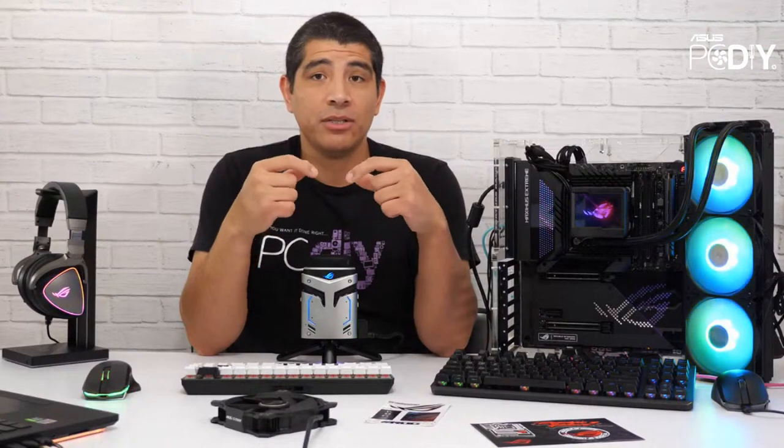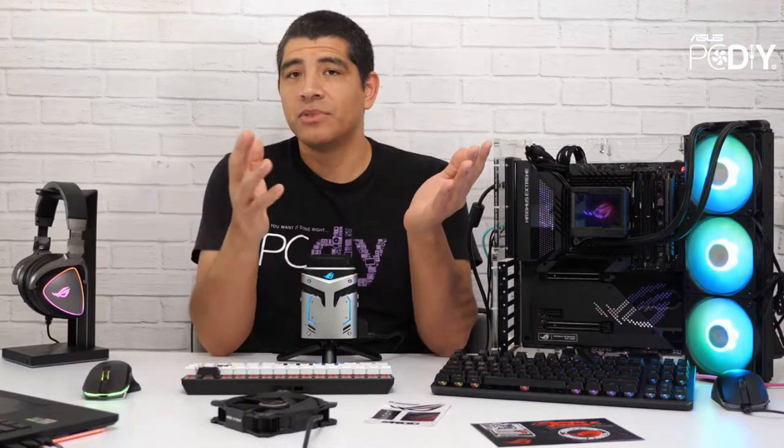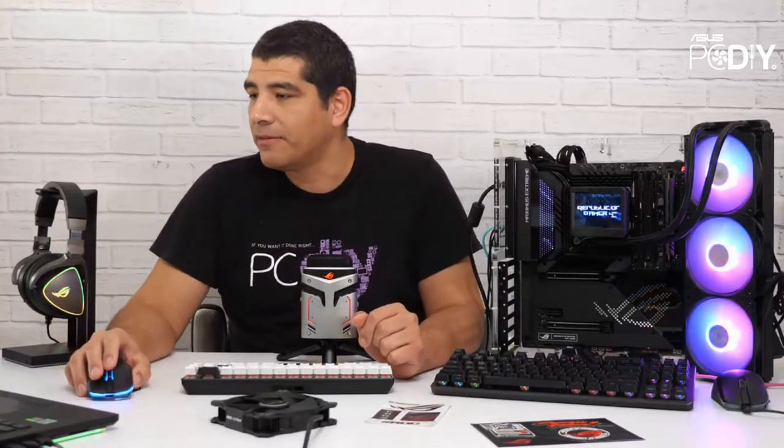It could be that you actually have installed it, but I've many times seen users not detail the entire experience. What I mean by that is they install it, they boot into Windows, and they don't see the volume. Well, the reason is that you still have to initialize, partition, and format the drive, right? So you would want to go to Windows search, open up Disk Management, and it'll then prompt you through the steps to initialize, partition, and format your volume. So that could also be the other factor right there.